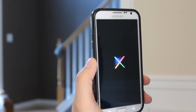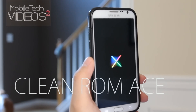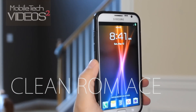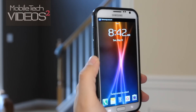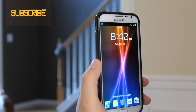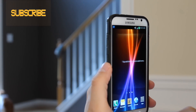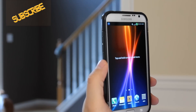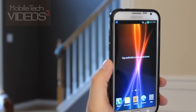As this is booting up here, we'll talk a little bit about it. This is Clean ROM ACE version, which I believe stands for All Carrier Edition, and this is indeed for all carriers. When you flash this ROM for the first time, you use the Aroma installer, and you can pick and choose which carrier you want. I have AT&T, and so that's what I chose, and you see LTE is working fine.